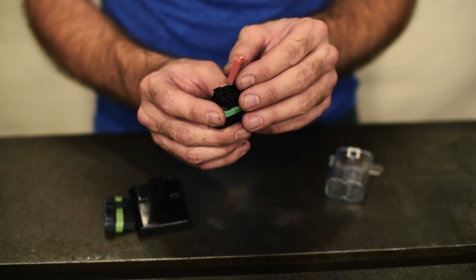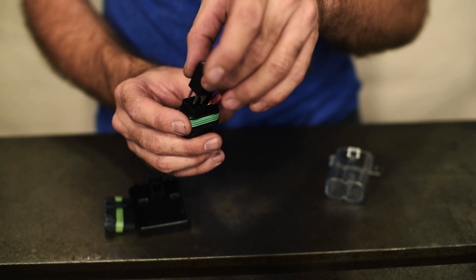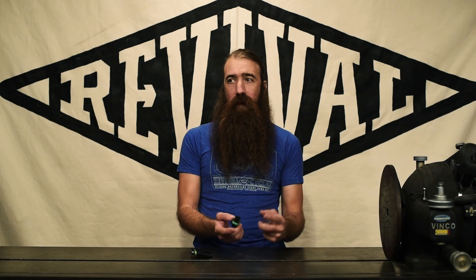There's a slightly added bonus with the four-position distribution module: you can actually fit relays in this as well. There's a micro relay that works just like any other relay, and you can fit two of those in here, or two fuses or circuit breakers and one relay. That works really great for an M-unit install on a fuel-injected bike — you've got a main fuse, a low-amp fuse for an M-lock or a gauge, and a slot left for a fuel pump relay. Most fuel-injected bikes have the fuel pump and O2 sensors controlled by the ECU, so you want that running on a relay. This gives you the option to do that in a completely waterproof sealed package, so your relay never gets exposed to the elements and the contacts don't corrode. It still fits circuit breakers and fuses too.